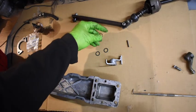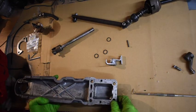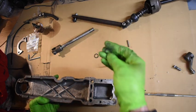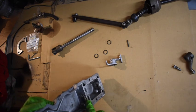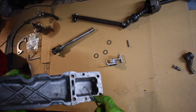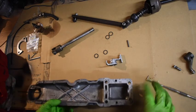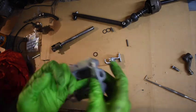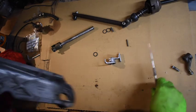I've decided to go the full way and replace the seals that sit inside here - a bit of a pain, and there's the possibility that the new rubber is going to be no good very shortly. But I've just got one out and it's definitely harder, and I can see the wear on the inside of it. This bit is actually completely unknown - I've never had it on a car - so it makes sense. It's not proving too difficult to remove, just with the pointy scriber there. I've got the old seals out and I'm going to try and get the new ones in.